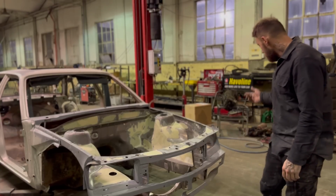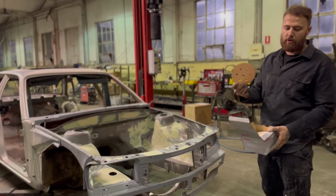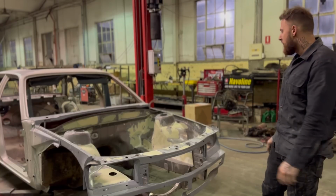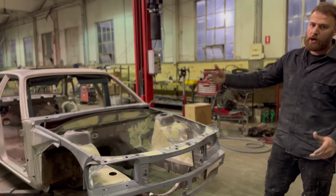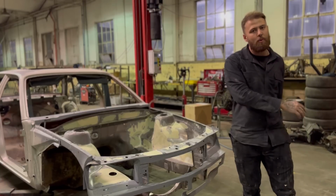And then, yeah, a lot of it is 80 grit orbital pads, orbital shaping the filler. Some of you are going to be like, whoa, what are you doing? That's dodgy. Don't care, right? On the body, yeah, don't do that on the outside of the car. But in an engine bay, you get away with it any day of the week.